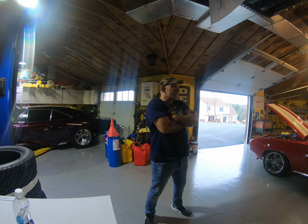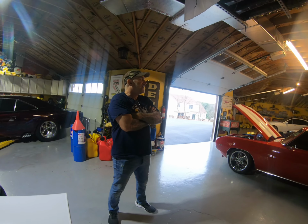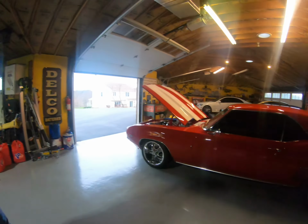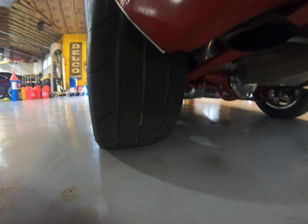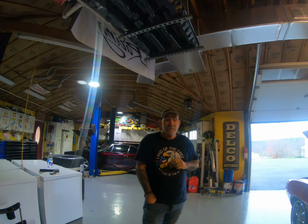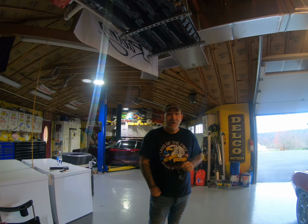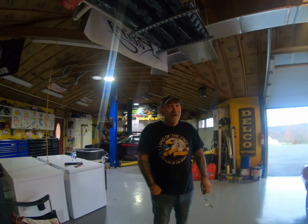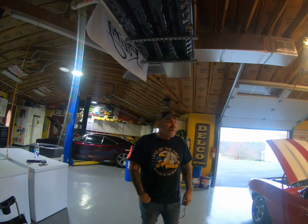If you look at that tire and the suspension that's underneath it, I carried that over to Zeus because I fell in love with it. Basically, it's the Caltrax. It's a simple concept. This is a 1,000 horsepower car on 275s on both sides. The tire compound is super soft, so they don't last very long, but you're still putting 1,000 horsepower down. What's really crazy is I was able to hook this car up on the street with those tires. It doesn't always happen. Agreed, you've got to get the right road.